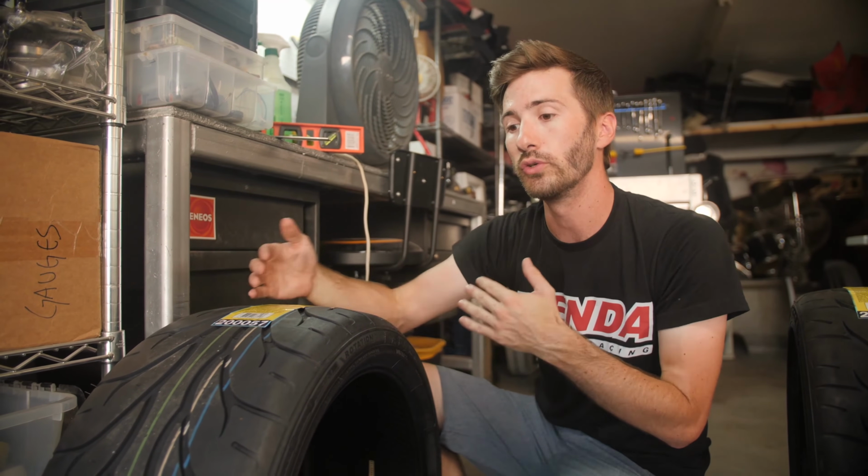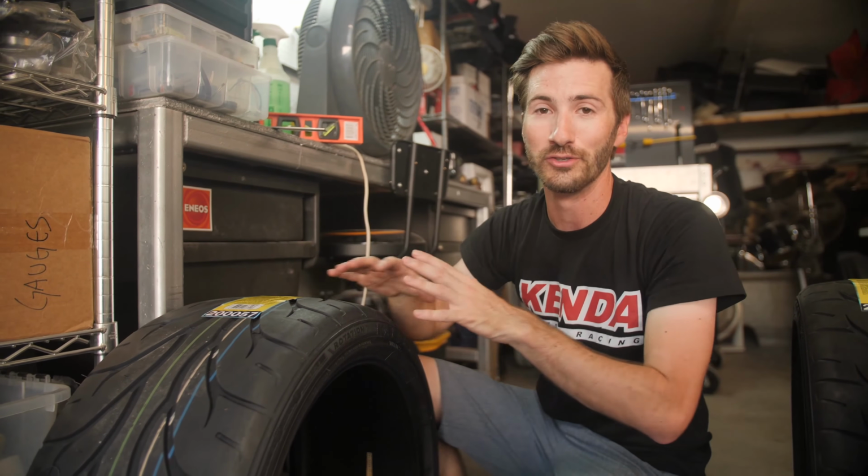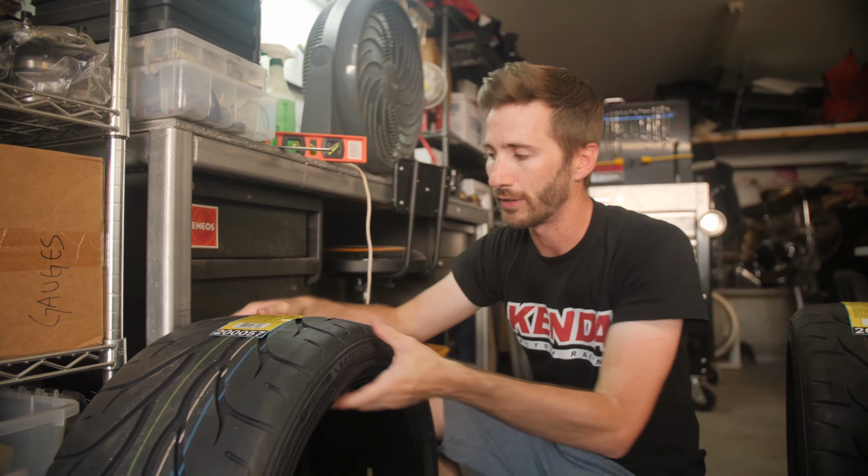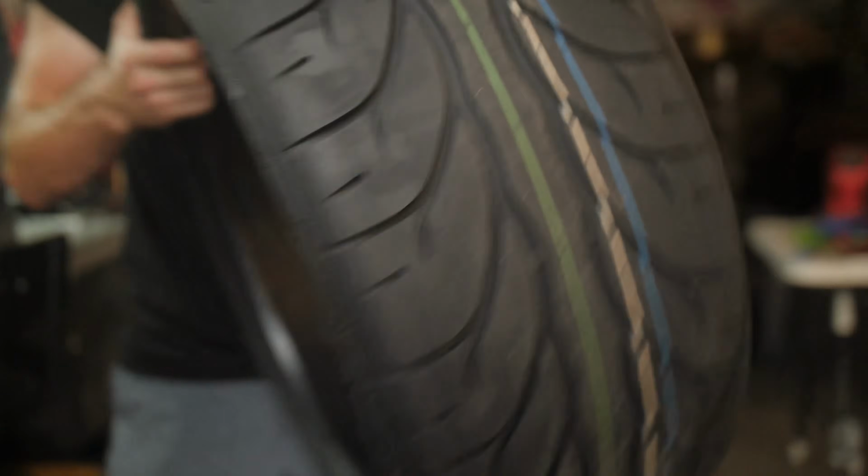And when it's balanced, it's much easier to drive and it's much easier to tune a little bit of oversteer, a little bit of understeer, and so forth, and make the car feel exactly how you want it to without having to do drastic changes with tire pressures or shocks or spring rates and stuff like that. So this is the golden child.